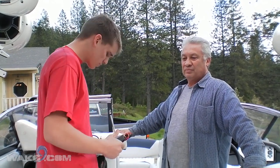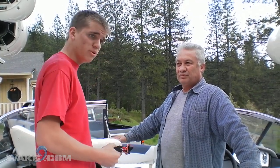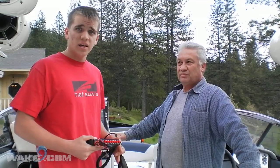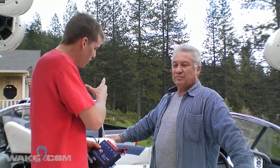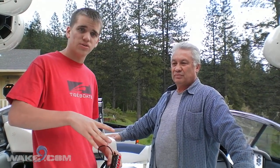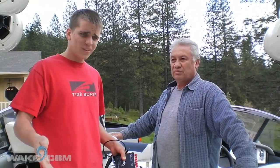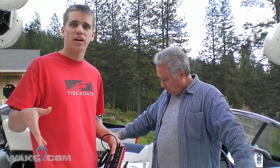One of the big things he stressed is make sure that all of your audio equipment, your radio, your amplifiers, and your equalizer, are all running from the same battery. He said you want to make sure they're running from the same ground, because if you have your radio running to your primary battery, and then all your amps and your equalizer running to your secondary battery, you can get a ground loop. Basically, a ground loop causes hissing, and it causes sound you don't want in your stereo.